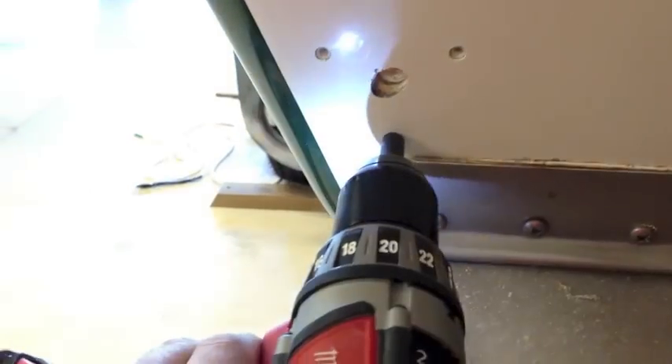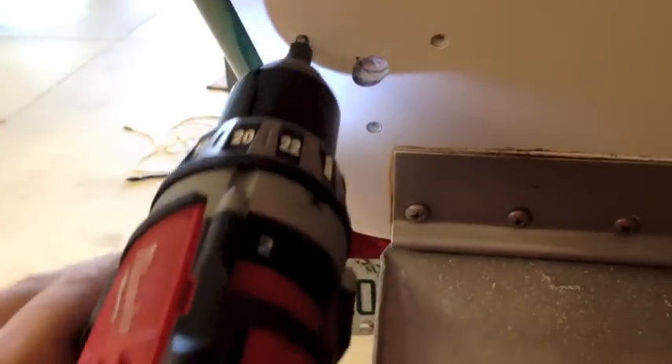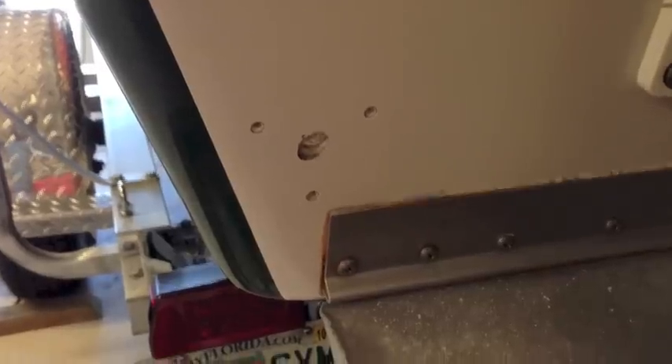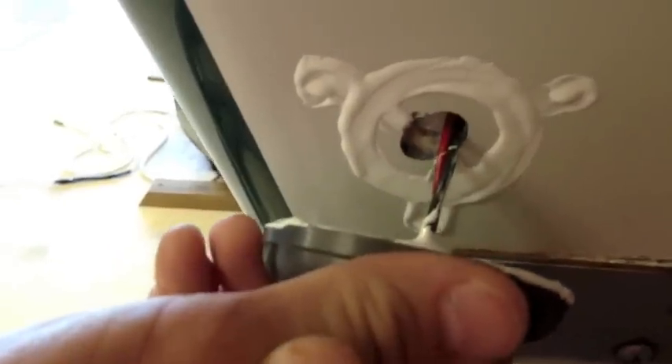Slightly open up that hole. This super simple step will prevent any kind of spider cracks from coming out around the edges of these screw holes. It's also a good idea to take a vacuum and clean it. These larger countersink holes also provide some area for a little extra sealant to sit, so we're sure not to get any water in these screw holes. I'm not going to put any sealant in this center hole until after I get the wires in. I'm going to try to get these wires as close as I can without touching the hole — angle it down just a bit. Perfect.